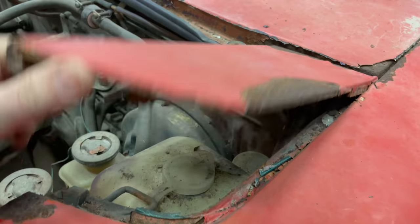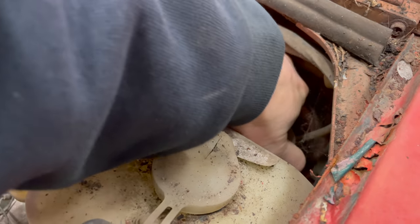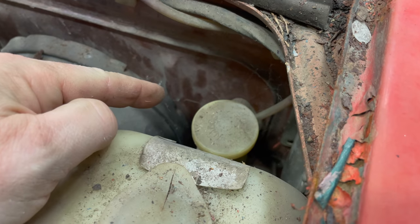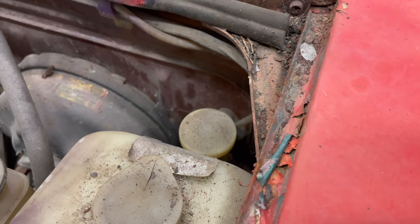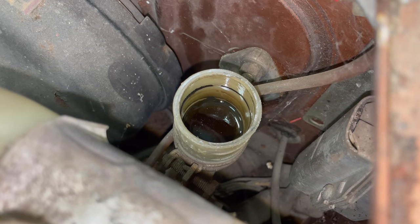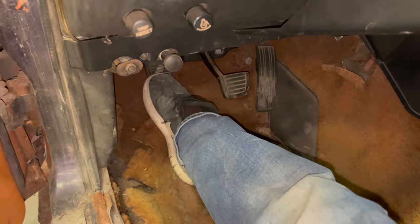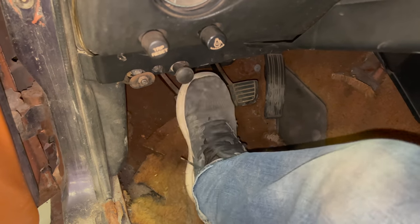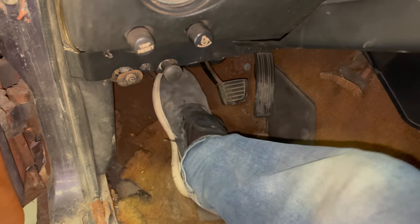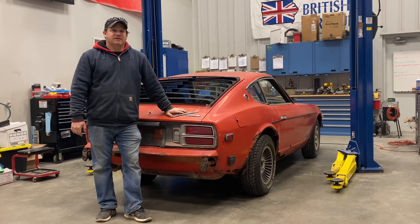It's about five o'clock at night with just a little daylight left, so if I can get the clutch working we can find out if this thing drives. The clutch master cylinder is right here — I'll try to get this cap off and see what it looks like inside. I got the cap off and there is still fluid in it, which is a good sign it's not leaking. Pushing on the clutch pedal there is zero resistance, so I don't think it works. I think someone pushed the pedal and it pushed the piston in the master cylinder back, where it got stuck with nothing but spring pressure. Well, I think that's it for today — I was hoping to get it running and driving but I'd probably need to order parts for the clutch and brakes. If you want to see more videos like this, comment below and click subscribe.